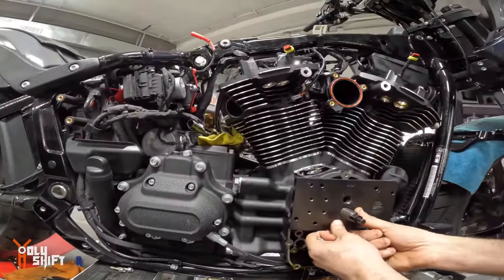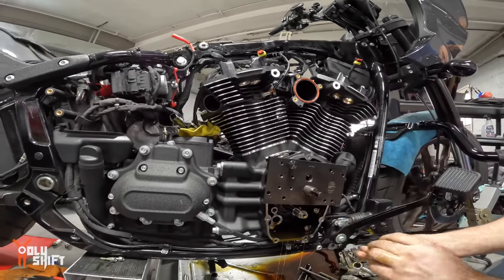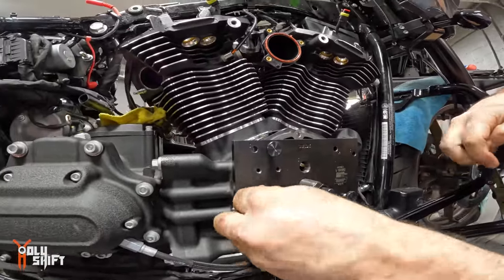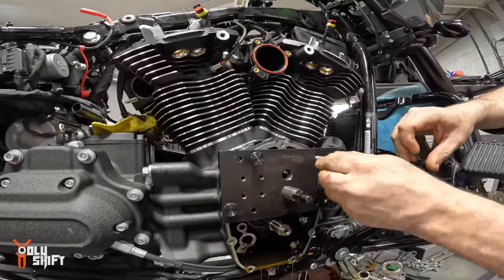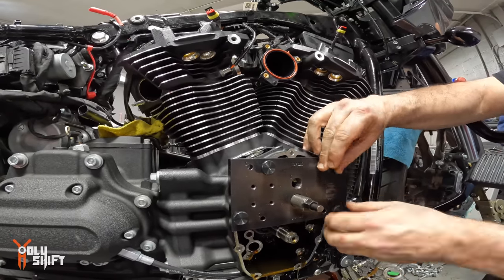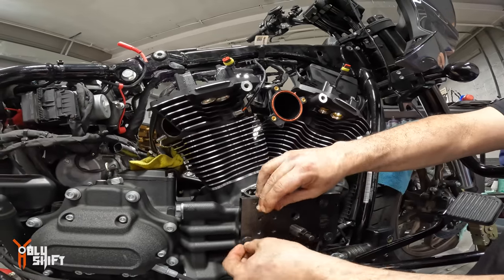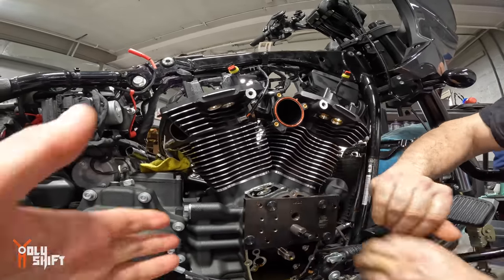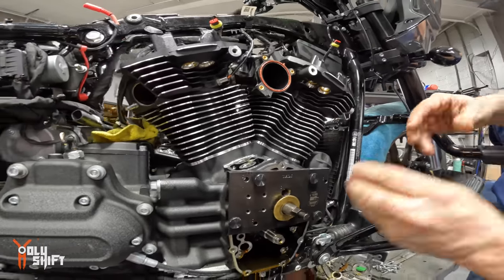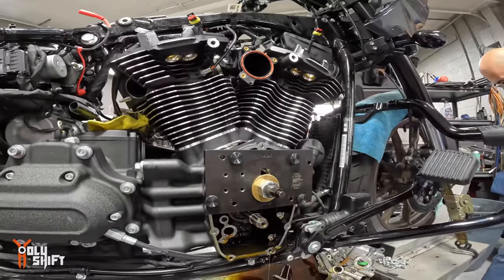Do we use the hammer? No, we use the plumber wrench. Okay, yeah, the red one. There's a side for extraction and a side for install. It says remove and install. When you put these bolts in, you use the remove side, because we're removing it. Look at that, it can be no easier. Otherwise, if you try to pull it out when it's not exactly aligned, you damage the actual casting. Pulling it out, you can always get it out, even if it's not aligned. Pulling it in is when you get in trouble. Pulling out at the right time makes the difference.